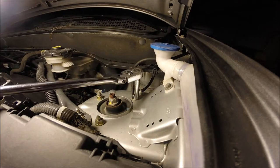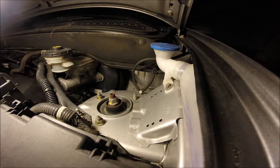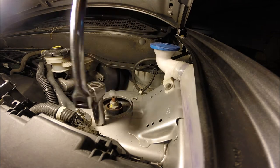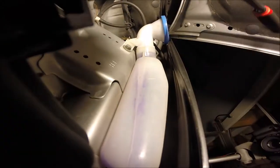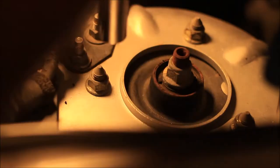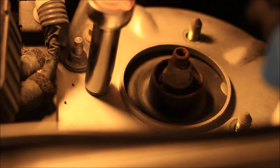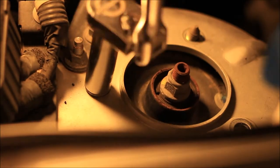You've got three bolts at the top of the wheel well - I believe this is the driver's side. You just loosen them. I'm throwing everything away underneath so I'm just going to let it drop, but if you like your CV axle and it's still down there, be careful - just reach under, keep a hand down there, and grab it once it comes loose. Here's the same thing on the passenger side. It's going to be obvious which side goes where, but I tend to keep them separate so I don't forget.